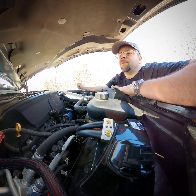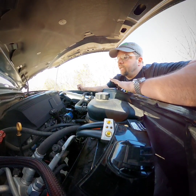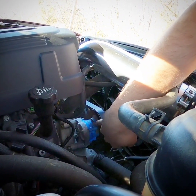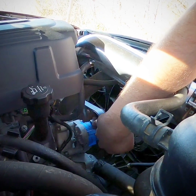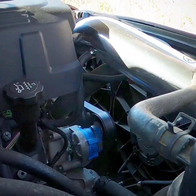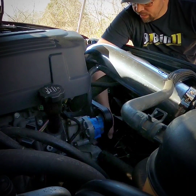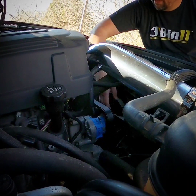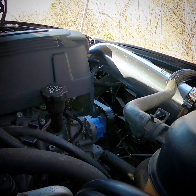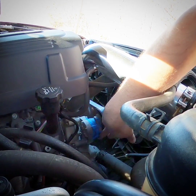On these we state you need to use a shorter belt. Just read the directions — it's all in there. When I put the stock belt back on, the tensioner came up and actually touched the limit — it was just resting on the stop with no movement. Very, very bad. You're not getting what you need out of it. If you can grab your belt and it doesn't move, that's bad because movement is what puts tension on it. If you have one that's too tight, it'll be bottomed out on the other side — there's a stop there as well.